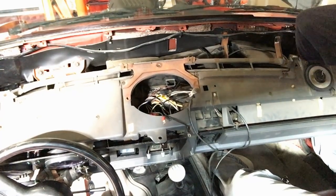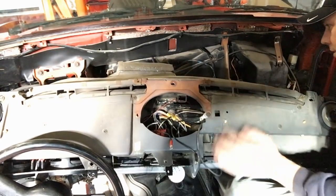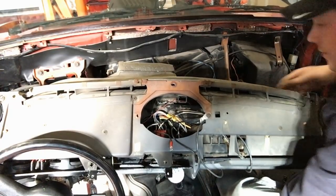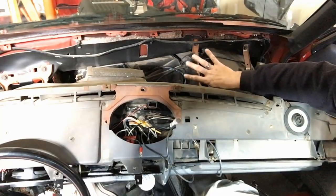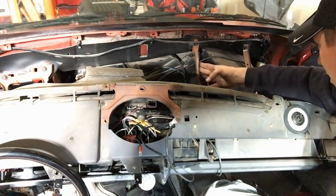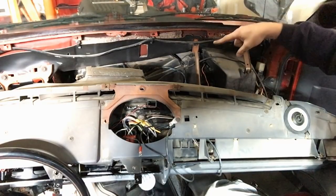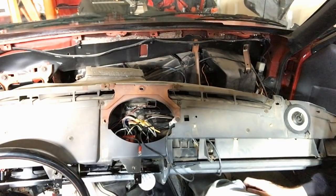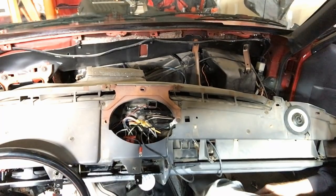There are a few wires and clips on this side that you can pop loose to give yourself a bit more room and let it sit down. You can see I've got all this stuff loose — over here is where we're going to do the majority of the work. There's the HVAC box, and your heater core is right up in here. A few bolts will drop it down, and then there are two bolts on the outside in the engine bay to pull it back, remove the cover, get the new heater core in, and reassemble.